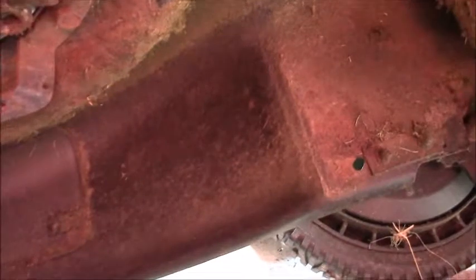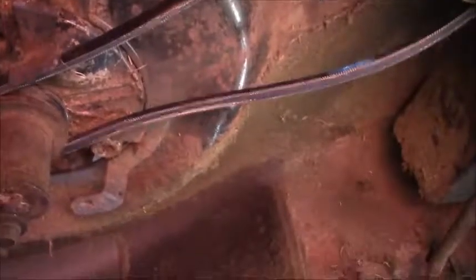So now we got the belt installed, pulley. Got to make sure that the belt actually goes through the guides here, and then down to drive shaft. That just goes up into position when the blades attach. Now we'll start attaching the cowlings. We'll start with the rear one, the discharge chute.